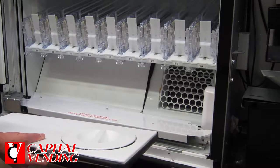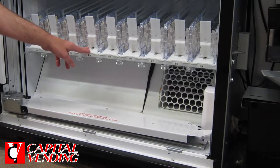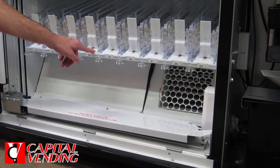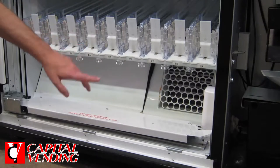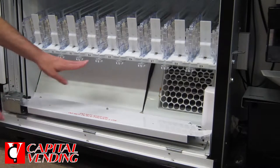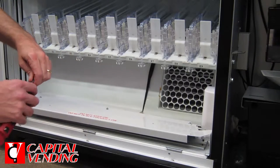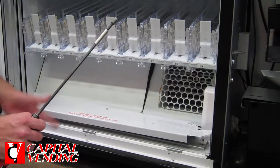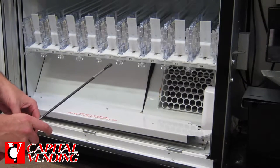Pretty easy — probably take about five to ten minutes on location. First step, I'm going to remove this tray. There's no wiring harness, so you're basically just going to undo two quarter-inch screws. Then we're going to take this tray out, and I'm going to need a 5/16th driver to loosen up four nuts to raise a panel that's under here. I recommend having an extension with a quarter-inch drive; if you have normal hand tools it'll just take a bit longer, depending on how many machines you need to update.